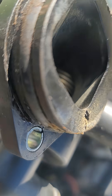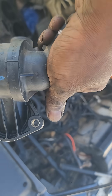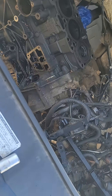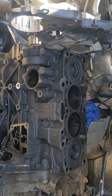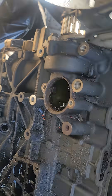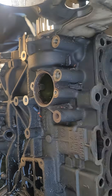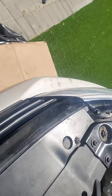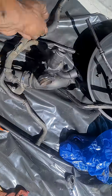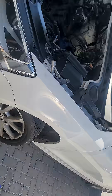I suspect if you look at the bottom, you can twist the bottom part and take out the thermostat from the bottom — it will be lying there on edge. The water pump is next to the thermostat. So next I'm removing the cover, then the water pump, then the thermostat. This is the thermostat housing with the thermostat inside for this car.